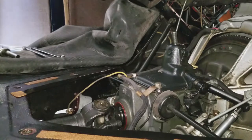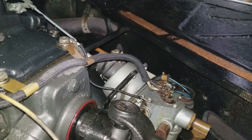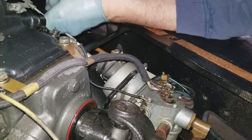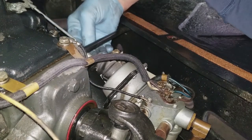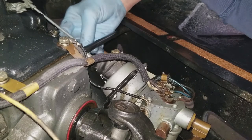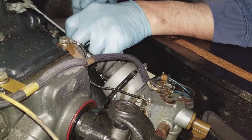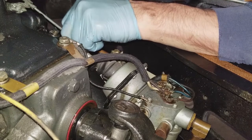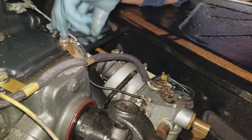Now the assembly's out of the way and there you have the actual transmission, which is a standard transmission used in all Terraplanes. All the electric hand items are added onto the system. Now we're looking from the driver's side back towards the passenger's side. The black loom coming from the top is the major electric hand wiring coming from the steering column and other points on the driver's side. The unit right there that I'm trying to remove a clevis pin from is the actual electric hand system added onto the side of the transmission for the shifting.